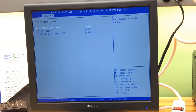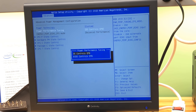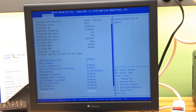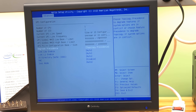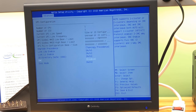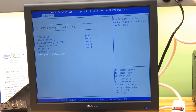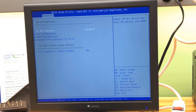Quickly showing you all the settings — you can pause the video if you need to see something more carefully. Heading back to Energy Efficient — it's only a four-core machine anyway, so I'm not going to focus on all kinds of benchmarking. Chipset — North Bridge settings, lots of new sub-menus. These might change quite a bit on the next BIOS release. For RAM speed, we got 2400 MHz — before, only the eight-core got 2400, everyone else got 2133. Looks like they fixed that, nice.